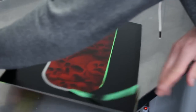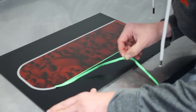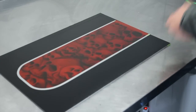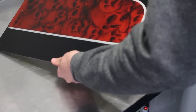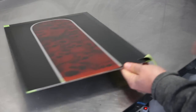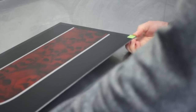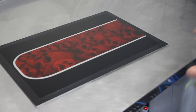Don't be aggressive when unmasking — just take your time and peel it back on itself so there's less chance of lifting. Because we've protected areas with Intercoat Clears it should help to make sure nothing lifts up. You could also two-pack clear it, then wet sand it, which will totally protect the area, but we're showing you the way to do it without having to go to all that trouble. All I'm doing now is removing the original masking tape to create the border, giving it a nice neat finish. And there you have it — the skull panel is complete.